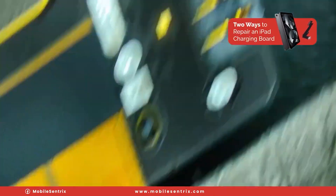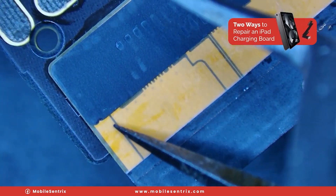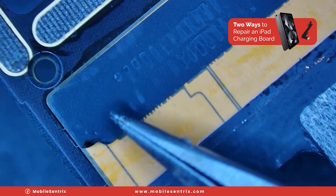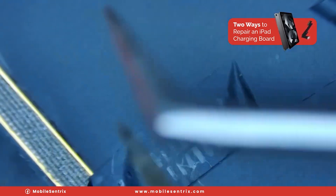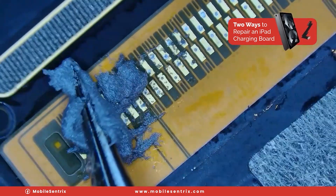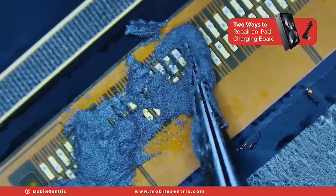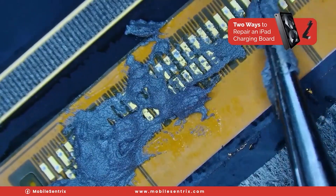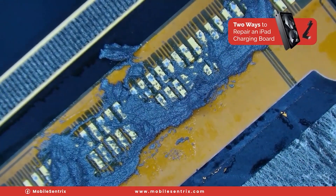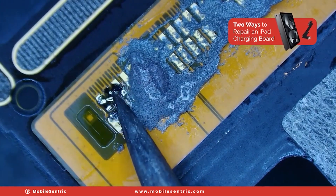Alright, so that is how to do the port repair. Now let me show you the other way — for those of you who want to do what might be the easier method if you've taken the time to remove the board. We'll peel up this sticker, set it aside so we can reuse it later, and I'm going to take some 138 solder paste. This low-melt solder paste will bring the overall temperature the solder needs to reach on the board down so that the solder lets go and we can get the flex off without pulling any pads. Let's turn on the soldering iron and flood all of these solder pads with solder.